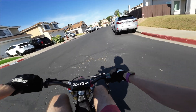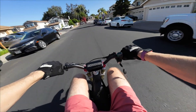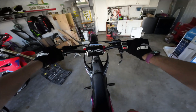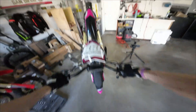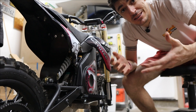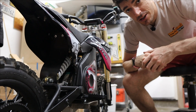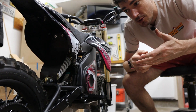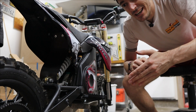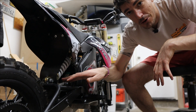Definitely feels more responsive, that's for sure. But let's see if it fixed anything with that crunchy throttle. And right there, there's our not-so-sweet spot still. So a few things I'm trying to troubleshoot to eliminate any possible issues with something external. One of the other things I was thinking of was maybe it's just the drivetrain. Maybe it just happens that at that RPM, it starts to vibrate and get juddery, and has nothing to do with the electronics or the motor.